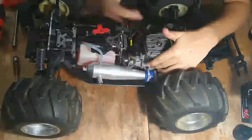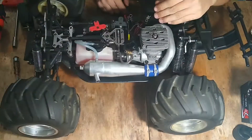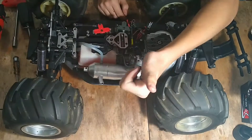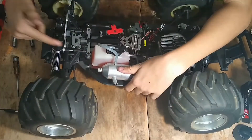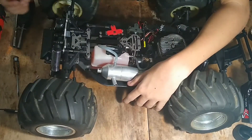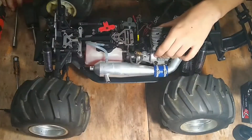Back to the EK4 — let me know if I'm wrong about the carburetor screw, and if you know the stock needle settings for this thing please let me know. My two questions are: why is it not starting, and which screw is the low-speed needle? Also, if any of you know where to find a body post for this, I'd be glad to buy one — you can see it's cracked right here. I checked for spark and the glow plug glows up really well, so that's not the issue.